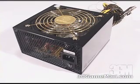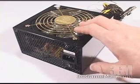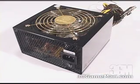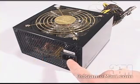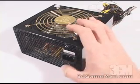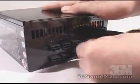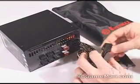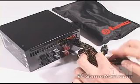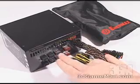Now let's have a closer look at this power supply. It comes with a 120 millimeter fan. This fan has no problem keeping the inside of the power supply cool. There's also additional ventilation holes. Here's where the power cable gets connected and the on-off switch. This power supply has a modular design. Now, the only cables that are not modular is the main 24 pin motherboard connection as well as the 8-pin motherboard connection. Everything else is modular and would get connected into the back of the power supply.